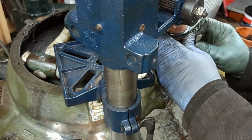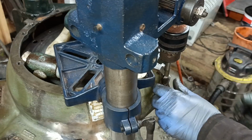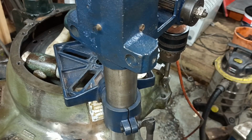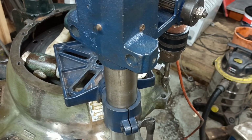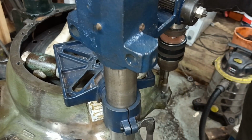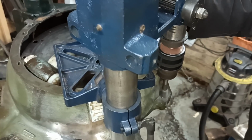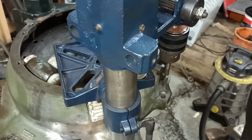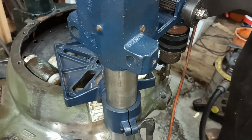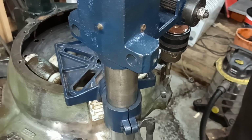I don't know how this will cope with a super high speed. The reason I have to use that diameter drill is because that spigot there is 10.5mm. I could have used a smaller drill, I know, and then stepped up to it, but hey, where's the fun in that? Something to work a bit hard, isn't it? It's much better controllable with the other drill. Still, it's working.